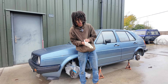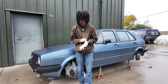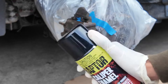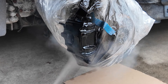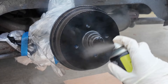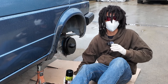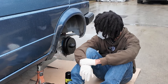Now that the UK weather is finished with its second moisturising session, I can get to spraying. Dry off the brake discs. Can't forget PPE — gloves, goggles, and a respirator. Give the can another good shake for two minutes and then begin spraying. Make sure to keep 15 to 25 centimetres away, trying to spray an even coat throughout the whole caliper. After spraying the first coat, you should wait 5 to 10 minutes before spraying the second.